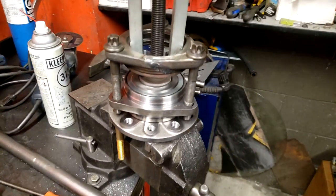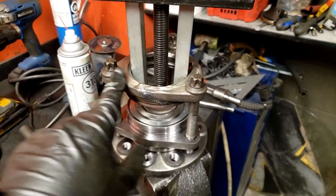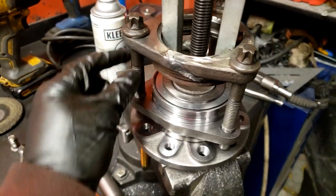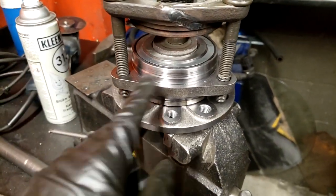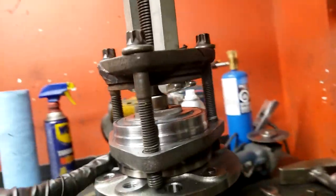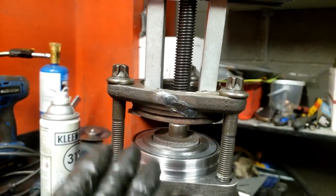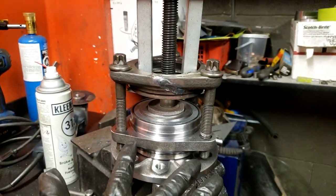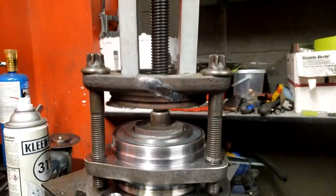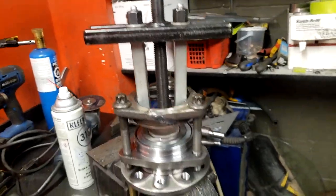So I need you to take in this press fixture real quick. This is the first wheel bearing I cut apart. This is a piece of it. Drilled those holes out. These are cylinder head bolts, same thread pitch as the wheel bearing. And then I'm using that for a gear puller to hold on to pull this up. So I'm trying to pull the actual bearing housing off the hub, because that's machined, and that's a crank pulley washer and then a bolt, and then yeah.